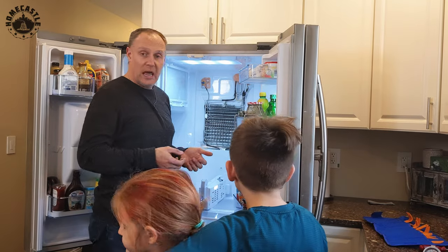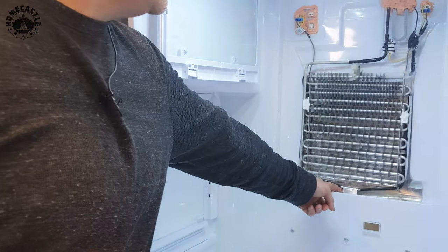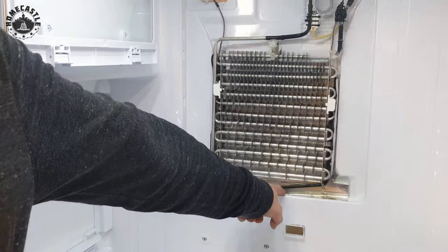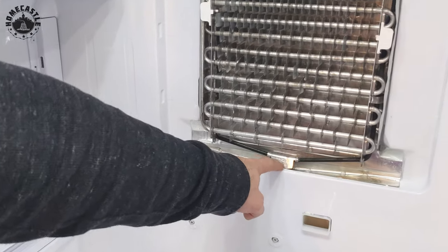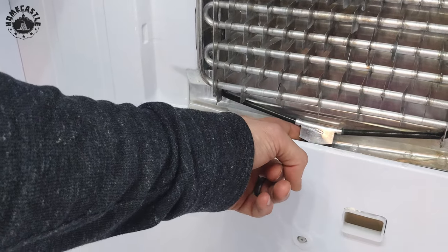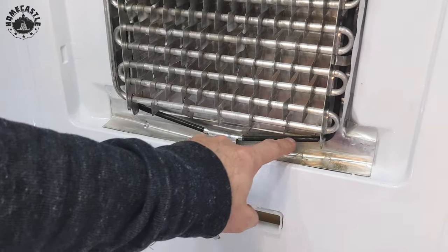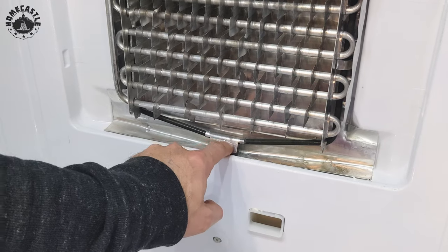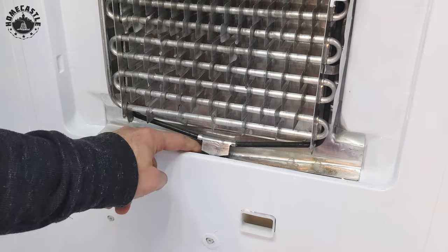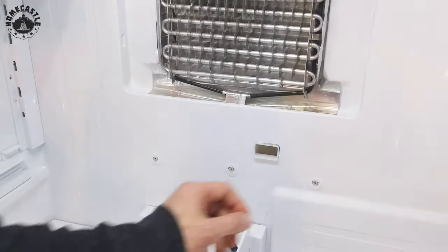One more thing to check: there's a little piece of aluminum clamped on the heating element that sits in the drain tray. Sometimes this drain can become clogged with gunk or ice, so make sure while you have it open that you clean this out. In theory when the heater runs it also heats this aluminum tab, which reaches into the drain hole to help with defrosting. Check that before you button everything back up.